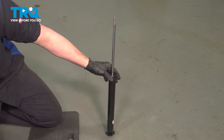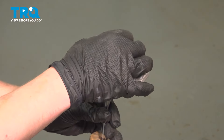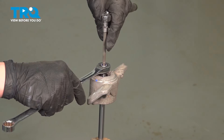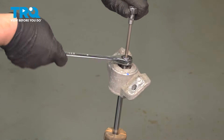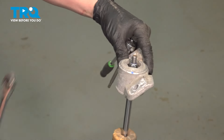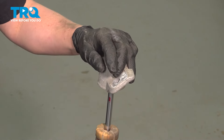Remove the plastic at the top. Install the bump stop assembly. Install the top bracket. Install the nut. Using a 15-millimeter wrench for the nut and a 5-millimeter hex head to hold the shock pole, snug the nut down. I'm going to make a small mark on my shock pole so I'll know if the shock pole is twisting as I'm tightening the nut.